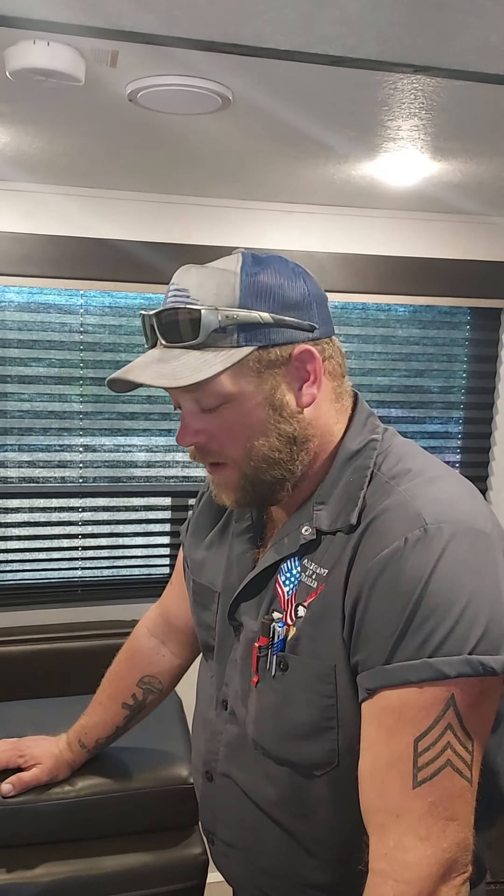Hi, I'm Nathan with Legion RV and Trailer. I'm here to show you a couple of things today. We're preparing a unit for winterizing — I say preparing because we're doing the winterize but we're also preparing to put a cover over top of the trailer, which involves a few other things. The customer does not plan on having their unit plugged in over the winter, so we're going to be removing the lead acid battery from the tongue box to prevent it from freezing. We'll give it to the customer so she can put it inside her house to keep it warm.